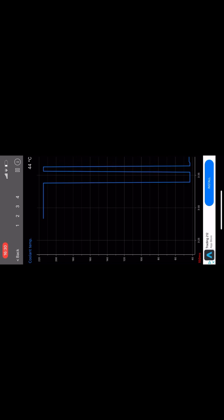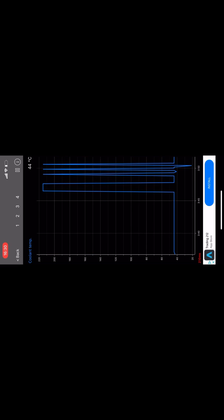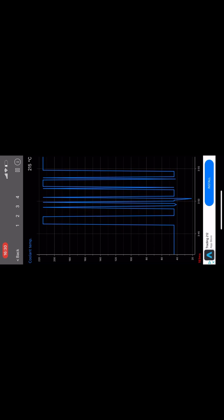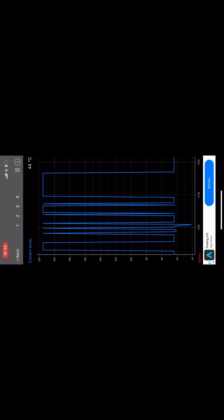Alright, here I am accessing the coolant temperature sensor. You can see the reading going from 215 degrees down to 43 — that's me pushing the frayed cable closer to the actual sensor. That turned out to be the real fault: the cable going to the sensor itself was the problem. You can see me trying to wiggle it into a position where it holds a stable reading, but it just wouldn't stay.